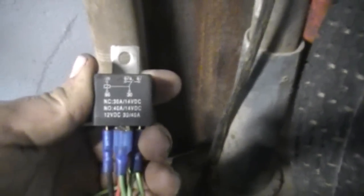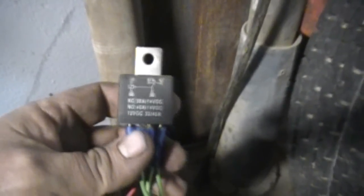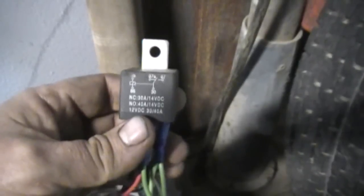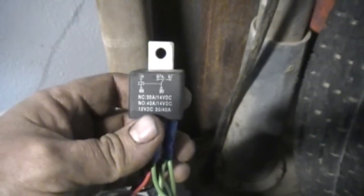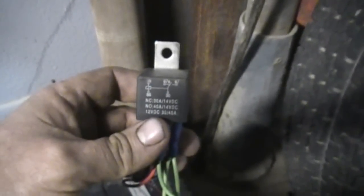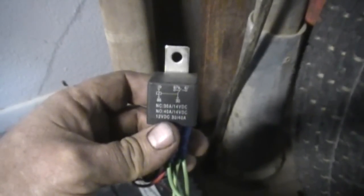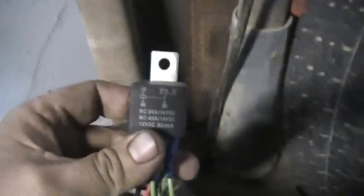This makes it harder for your car to get stolen. It's not a perfect cure, but it's simple and you can hide this relay where they can't find it. The only thing to remember is you don't want to put this too close to the ignition switch, because if they cut your wires after it they can still hot-wire it — so you want this far enough back to where they can't hot-wire past it. If you've got an older car with a points system and a resistance wire, it's got to be between that resistance wire and the ignition switch. Other than that it's real simple. Relays don't cost much — this one's out of a Ford, but this type of relay with this wiring diagram is available in many different forms. I'll give you a diagram at the end of this you can copy on how to do it.